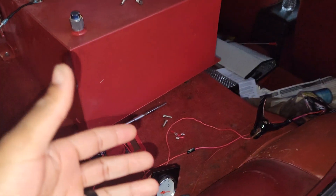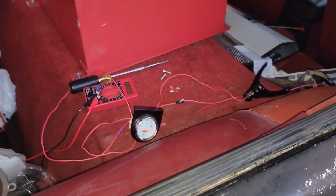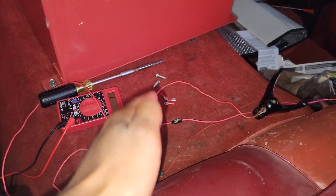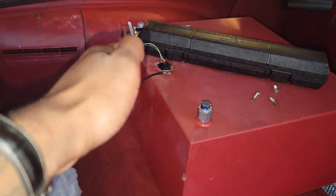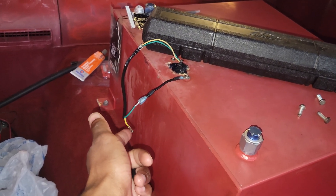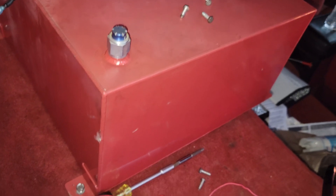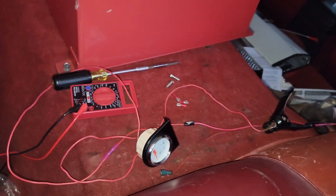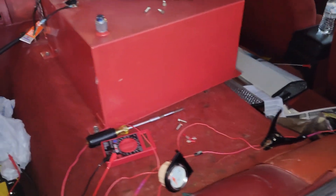When you're wiring up an aftermarket fuel level gauge, the fuel level gauge itself needs power and ground. Your fuel cell needs ground — for me the green wire is ground. All you need then is the yellow signal wire to go right to the signal terminal on the gauge itself, and that's it.